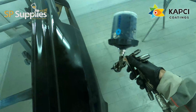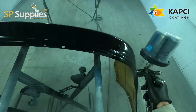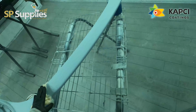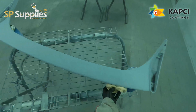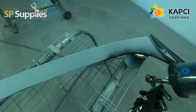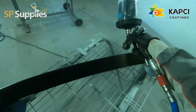Obviously, say on the bumpers, if you're repairing really flexible bumpers, try and use some of the proper plastic filler rather than the bumper filler, rather than your standard filler. And it's only on really flexible ones like this that I personally think you need that. The MX-5s, a lot of the older Fords have all got this same kind of, it's almost like a foam based plastic. I'm not sure what the plastic is, so don't quote me on that because I'm not a chemist or anything, but they are extremely awkward to repair if they're cracked, and they really do over flex. So to make sure that any flexing in these doesn't affect the paint down the line, I'm just using that little bit of added flex additive.